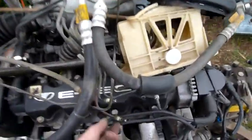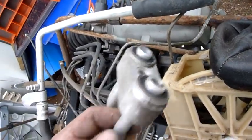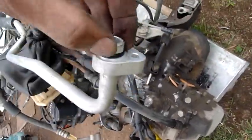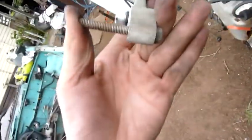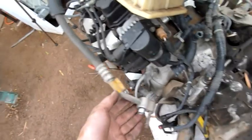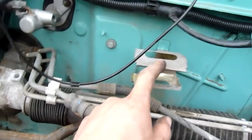Alright, well, I've got the brake line flare fittings and everything off, and the refrigeration fittings for the air conditioning. They're all bolted connections, with O-rings to seal them. Pretty easy. Just undo the bolts and studs and pull it apart. That's to the evaporator core, through the firewall. Fuel filter bracket, I'll take that off and keep it because I've got a spare filter for one of these.